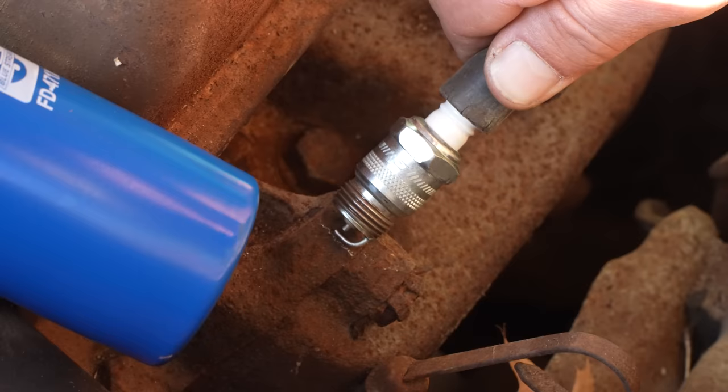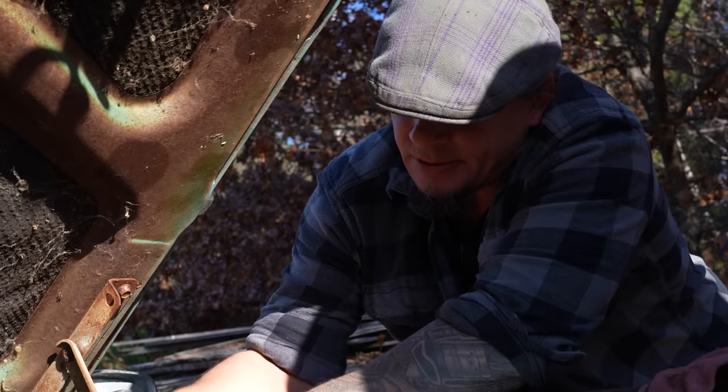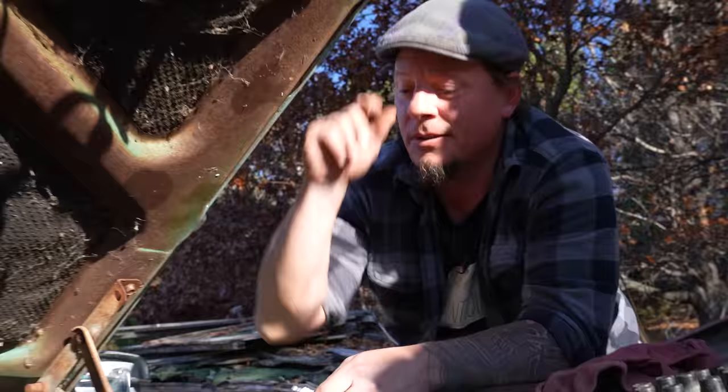That's a better spark. Is it? It's better. It's not like a blue, but it's not a faint orange either. Okay. All right, well. I think that coil is still good, the old one, but because it ohms out well, who knows? Yeah, maybe I don't disagree with you. Maybe it's not saturating well enough.